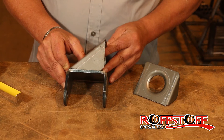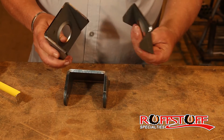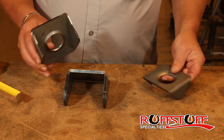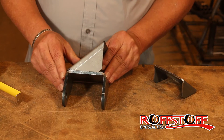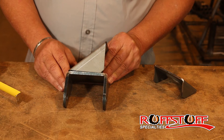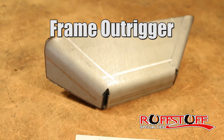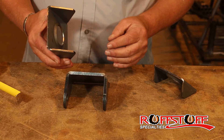When you're looking at this, this is probably too much offset — you're gonna put an awful lot of stress on the side of the frame. Now these are both 10 gauge, which is an eighth of an inch, and the dimple die really strengthens it, but if you've got to go this far out, you're probably going to want to use our frame outrigger, which is a lot more structural. These will certainly do this job, but those will do a lot more.